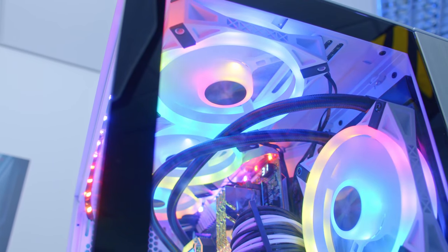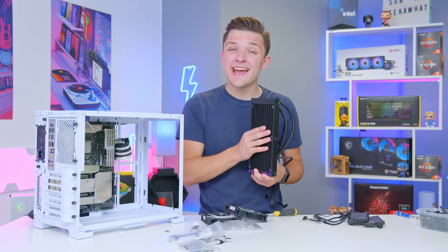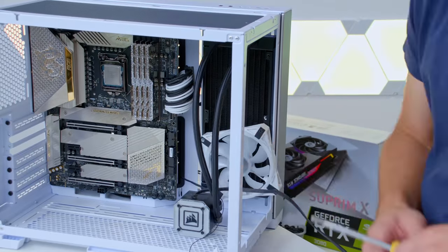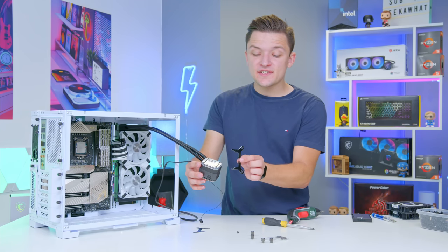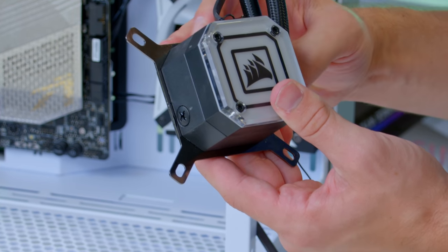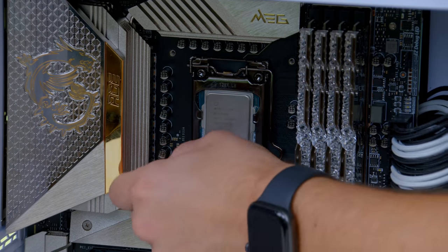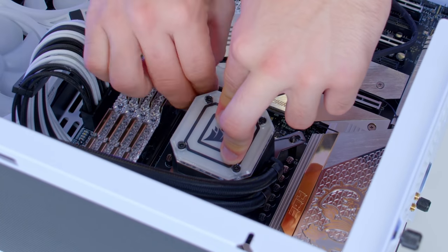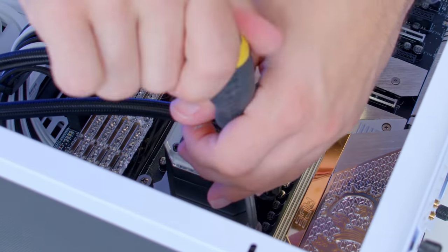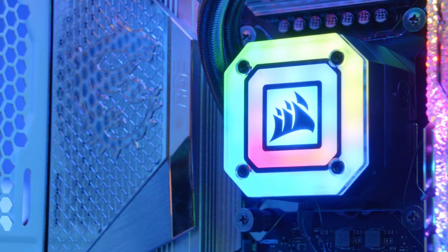With that disaster safely averted, I'm going to go ahead and pop the radiator into the case with the water block sitting on the CPU. Let's do the radiator and fans first, then I'll talk through how you install the water block itself. To do this, you just need to take the included brackets which slide onto the bottom and top of the CPU water block, then take the included thumb screws to fasten the cooler into place. Pop these LGA 1200 posts around the CPU, slide the water block on top, and fasten with those thumb screws. It really is that simple. And don't forget to add a drop of thermal paste — a tube comes included in the box.